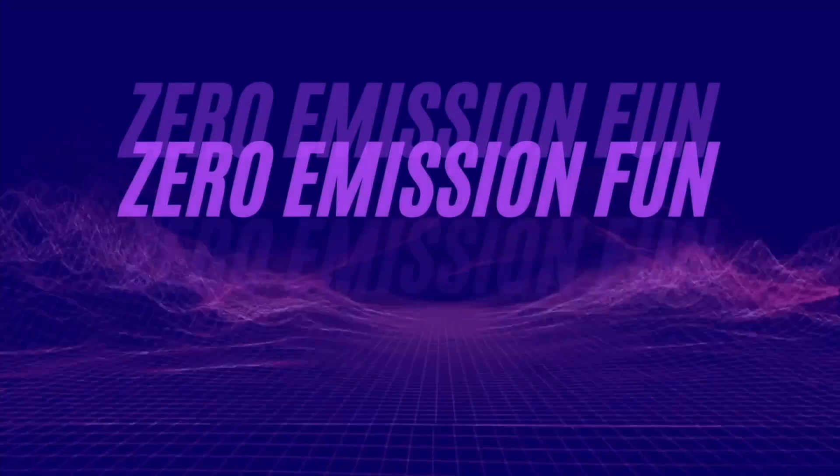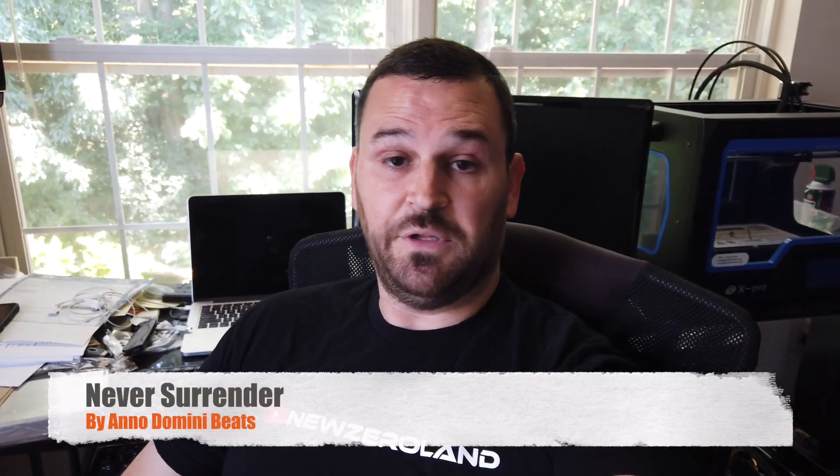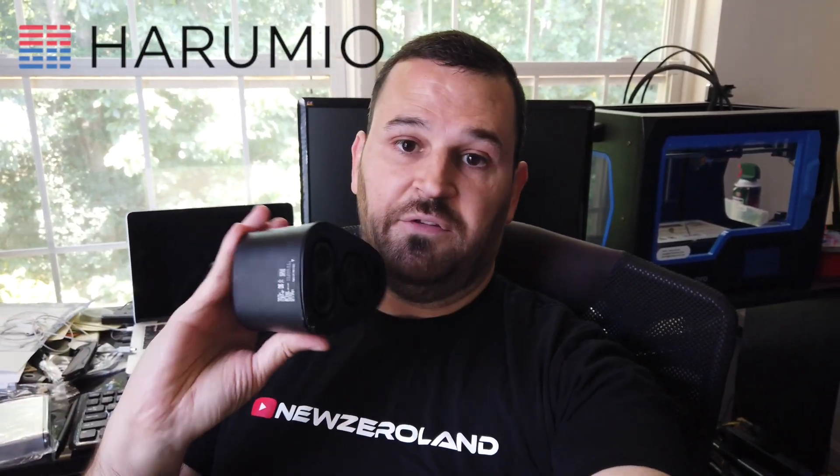What I'd like to do is buy a CCS adapter from Korea and enable my 2018 Model 3, because it's not currently CCS enabled, and see how much cheaper that could be than supercharging. So that worked out really well. There's a company in South Korea that'll ship this to you in like a week or two, about $310 everything included, and it's a genuine part. This isn't a knockoff adapter — this is the real deal. It'll do over 200 kilowatts, which is actually faster than a V3 Supercharger in the right conditions. The only thing I have left to do is call Tesla and have them install a Gen 4 ECU on my car so it'll be CCS enabled.